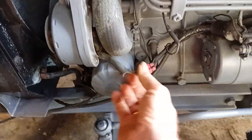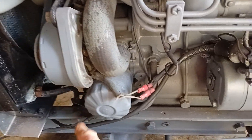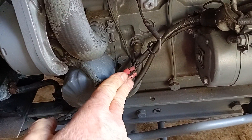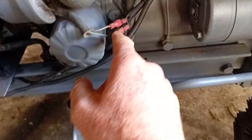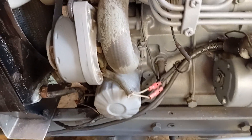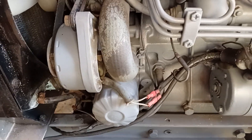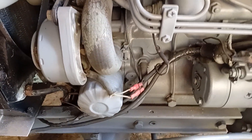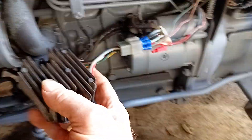Get to the wires coming out of the alternator. Most of the time there are two blue wires. This is actually a little two-phase alternator — alternators produce alternating current, which is why we have to be on AC. Measure the voltage with the engine running on those two wires. If you see something like 22 to 26 volts, the alternator is producing voltage but it's going nowhere — open circuit. If you have no voltage with the engine running and the alternator spinning, the alternator is bad — replace it.